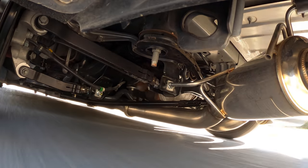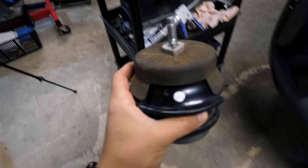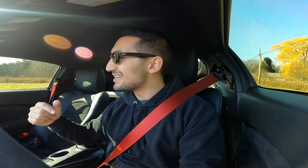That completes the install — I just need to bolt the exhaust system back on, then we can take it out for a rip. It's been about two weeks since installing the mounts and the difference is insane. This is after having an EQ Tech upgraded tune which remaps the throttle map for better throttle response. Even with the tune, soft engine, transmission, and subframe mounts mean you're waiting for all of those mounts to torque up before the car gets going. With these upgraded mounts, that's almost entirely solved. However, the differential still moves — the subframe now barely moves, but let me show you how much the differential still moves.